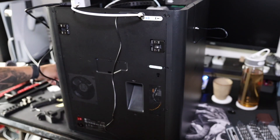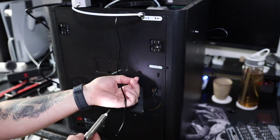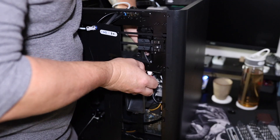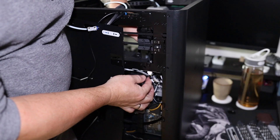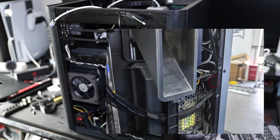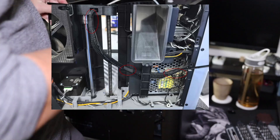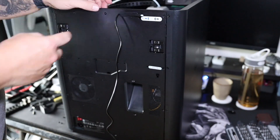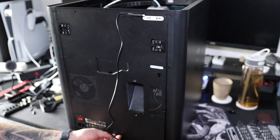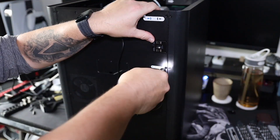We are going to fast-forward through removing the back cover. Remember that removing the plug and all the cables beforehand makes this job a lot easier. You see me fiddling the cable through, and I'll realize in a few moments that it's easier when I remove the back cover completely. Then you see pictures of where you can attach your cable and run it alongside the other cables already there. This last picture is very important: put it through the hole so it's centered underneath the bed. After that you can close the back cover, put the plug in, and continue.